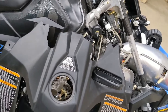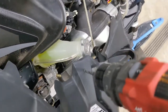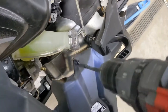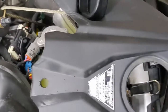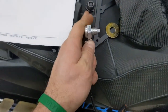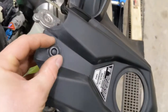For this next part, we're actually going to drill the hole now. The instructions say a half-inch bit, so I'm going to start with a quarter-inch. I probably don't actually need a pilot hole with plastic like this, but it's going to help keep it from walking around. So we're going to find approximate center and then drill our hole. Now I'm going to swap to the half-inch bit. I've taken the tether off from the switch itself as well as the nut on top. The first thing is you have to install this washer and then feed it in from the back side. Now we can go ahead and put the nut on it and tighten it up.